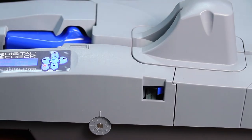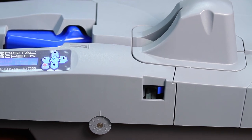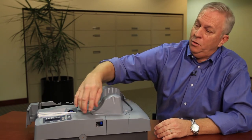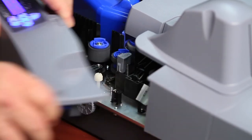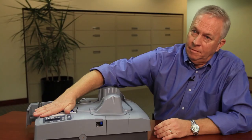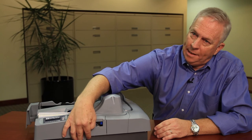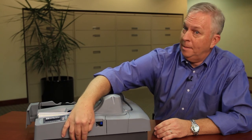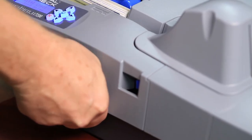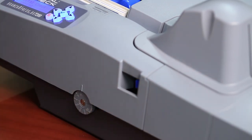Proper maintenance on these rollers will keep the performance of the scanner running at its peak, and you'll have fewer feeding and jam errors throughout the cycle. There is also an adjustment for the discrimination roller on the feeder. There's a little wheel on the bottom, and there's a sequence you'll go through to adjust this: first open up the door, back off on the little resistance screw about a half a turn, close the door, put some items into the scanner, and then start scanning. Tighten up one click at a time until you notice the feeding start to hesitate. At that point, back off the adjustment four to five clicks to get the optimum feeding adjustment.